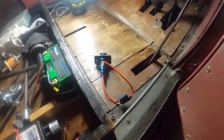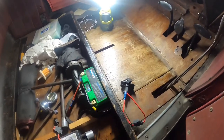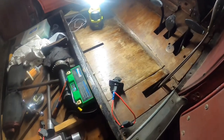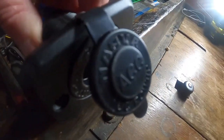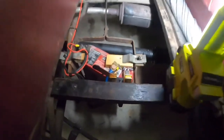So I'm going to run a unit through - I've got an inline fuse, I'll make up more wiring and run it through. It'll actually connect through to the car side of the knife switch, so it'll be isolated as soon as the knife switch is thrown to isolate the battery. It's got an inline fuse anyway, and I'm going to install it down into here so it will sit flush and then covers up - you won't even really notice it since it's black. I'll get on with that and come back to film the results.